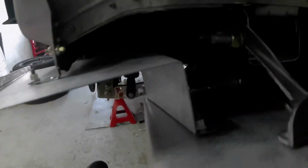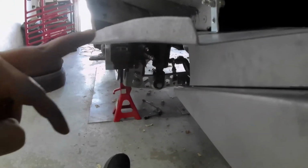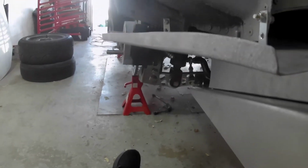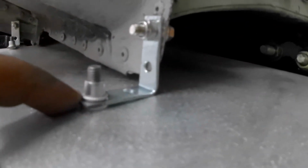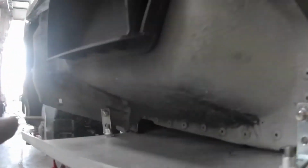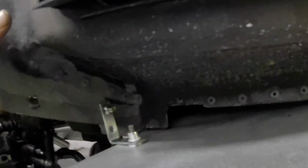You see it's not wobbling at all. I didn't want to have bolts going through the bumper. I think it would look cleaner without it. So what I ended up doing is a riv nut on a 1.5" L bracket. I'll put a bolt through here with a nylock on it. Same back here. So that holds that. There is a riv nut right here on the 90 and one up top, and they come through down here. So that's pretty strong.